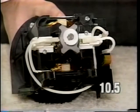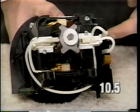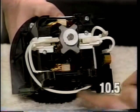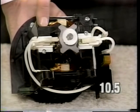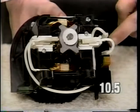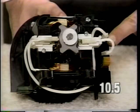One other source of a problem of a clicking motor could be if the motor was wired backwards at the power switch. The left brush lead wire loops underneath the motor and should come up and plug into the top terminal of the power switch. The motor housing will be marked with a B right above the brush holder. There will be a corresponding B either at the back of the power switch or the side of the power switch.